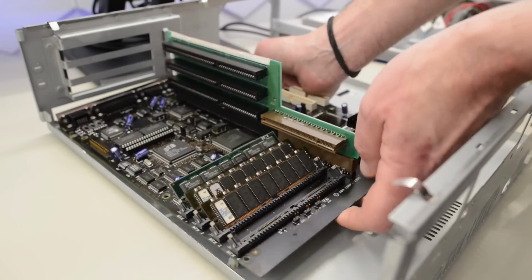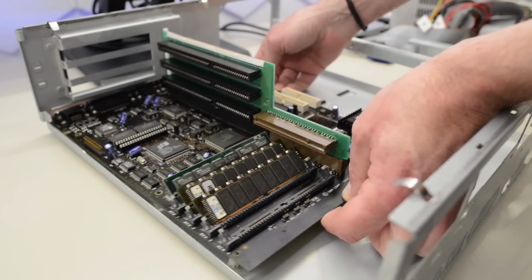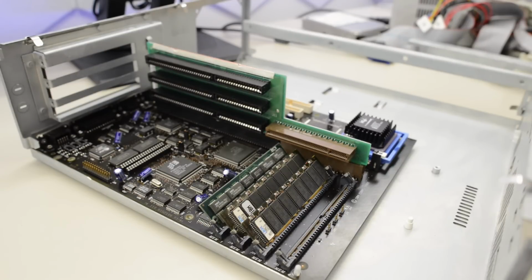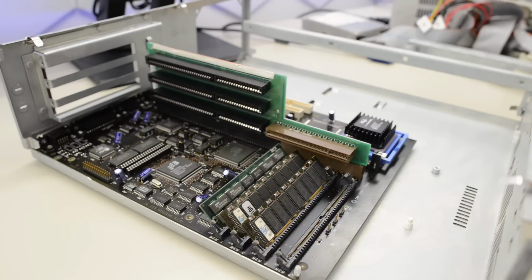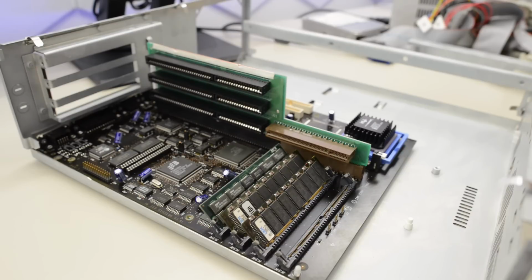I cleaned the chassis and all the other parts, so everything is nice and shiny. Unfortunately, this board is very picky with RAM. I was only able to add 2 more megs. These 2 RAMs are IBM branded, but one of the sticks that was already on the board isn't. I went through a whole stack of RAM sticks, but none of my other SIMMs would work on this board, except for one more stick. But that thing was 80 nanoseconds, so the performance dropped 2 FPS. Needless to say, I skipped it.